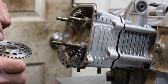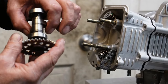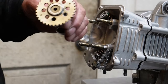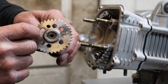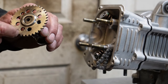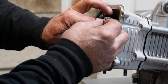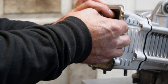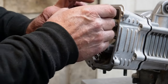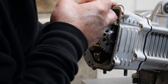We've got an A14 cam. Most of the time when the cams have a designation — so it has A14 — you basically flip it over. You always want to make sure the lobes are down. You see there's a series of holes, and there's a whole bunch of different style cam sprockets. There's a bunch of holes that are the same size. I'm looking at the center one, which is slightly smaller. Then I have my two dots on the side and they have a line, and that line basically has to go parallel with the head. Compared to putting a cam in the QMK motor, this should be fairly simple.